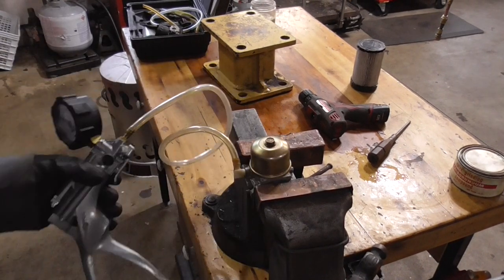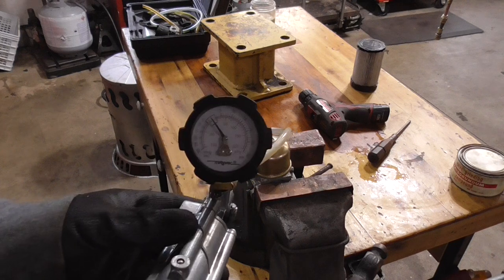What we're going to do is try to hone the seat, which is something new. I made a tool to do that and that's what this video is going to cover. We're also going to hone the needle. I did this recently and there was some discussion about how much pressure using a Mighty Vac it would hold. That question was from Kenny from Ken Small Engine out of Connecticut, so this video is for you, Kenny.